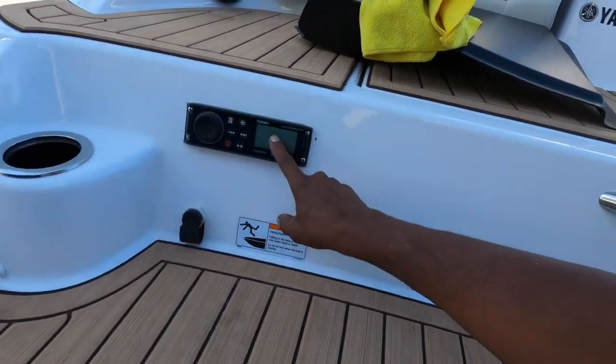What we're doing on this boat is stage one. We took the stock Yamaha — actually a Fusion radio — that ran all the OEM speakers. This boat had all JVC marine-grade speakers. We upgraded every speaker: three pairs of 6" and three pairs of 5.25" to all 6.5". We also added a set of tower speakers, two subs, three amplifiers, and a DSP.